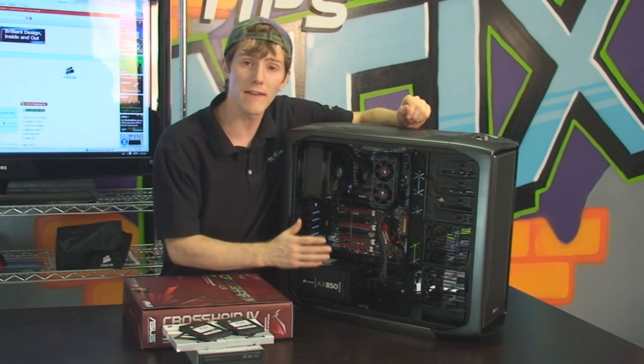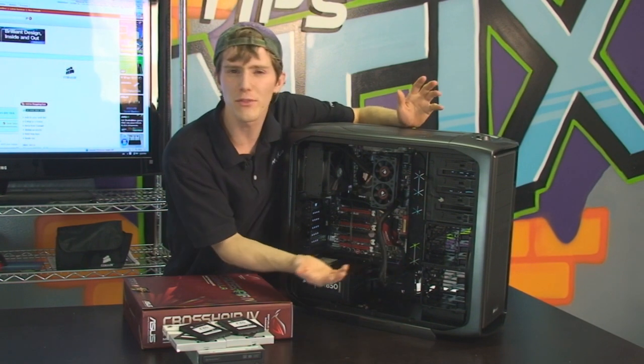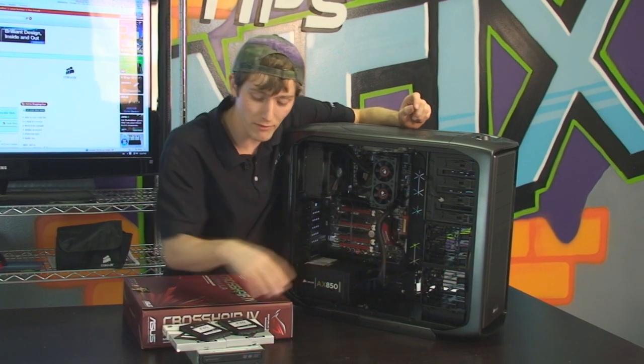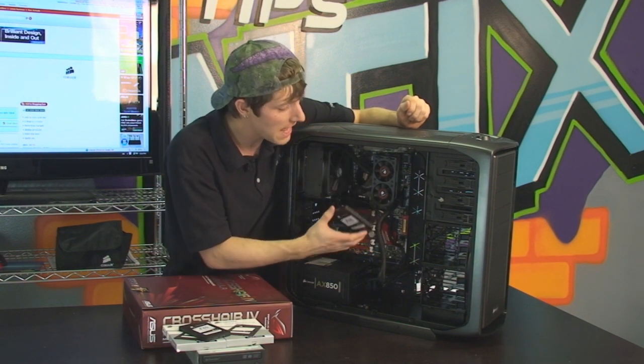Now with hard drives, you have some considerations like cooling when you're deciding where to put them. So if I had 3 hard drives, for example, I would probably put them here, here, and here to give the most space in between them for fan airflow to cool them off. With SSDs, it doesn't really matter. So my only real consideration is cabling and airflow.